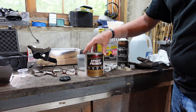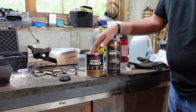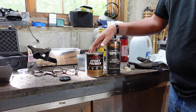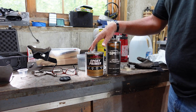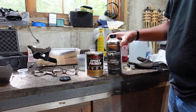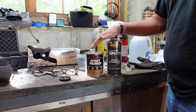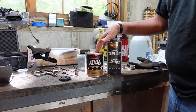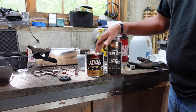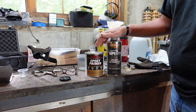What I got here is my Southern Polyurethane Epoxy Primer and Activator. This is a leftover from my restoration of the Spitfire, but the trick with this stuff is as long as you keep it sealed — sealed from the manufacturer, not like you take extra special care. The date on this activator is February 2020, but these have never been opened, so I'm confident they'll still work.